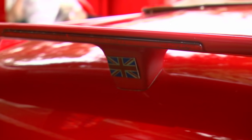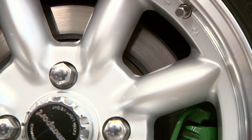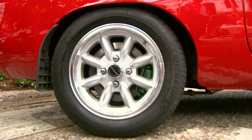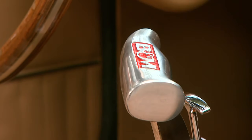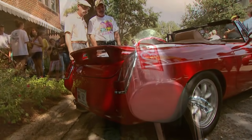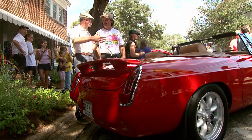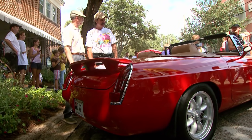I can't see any seams — that's a beautiful job. And I like your wheels, but it looks like you've got rear discs, and these didn't have rear discs, did they? No. It's a narrowed Camaro rear end that I put in the back. I had to change the rear end because I put in an automatic transmission and needed a different gear ratio — one thing leads to another. So you had to narrow that Camaro down too? Yeah, just narrow the rear end. Man, you're a working fool, I gotta tell you.